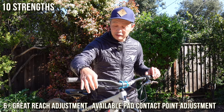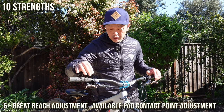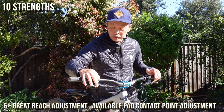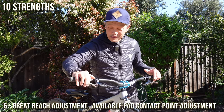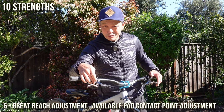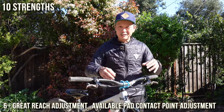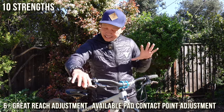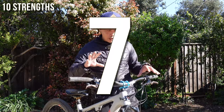Number six reason: I think it has the best-in-class lever reach adjustment. Lever reach is very important and you don't want to need tools for it — it's right there, accessible, not a knob that can break, and you can almost do it one-handed or with one finger. They also have a bite point adjust via a small Allen screw. I don't think you need it as much if you have great brakes — on my SRAM Codes I always use it because the bite point always wanders — but if you need it, it's there.